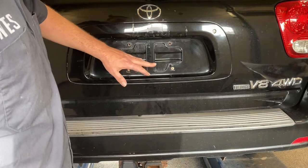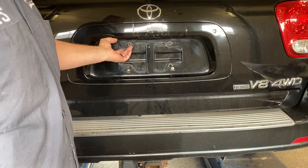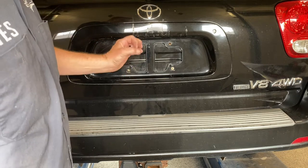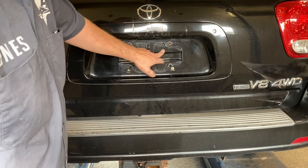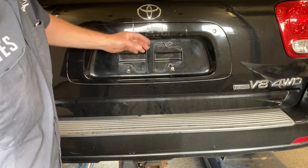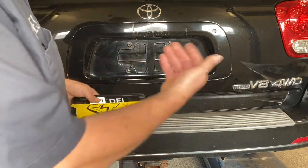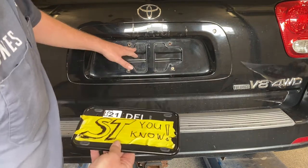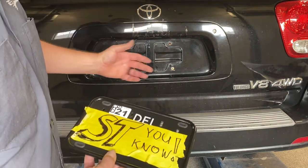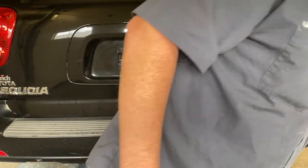A problem that Toyota is known for is the nuts — they're actually called nut certs. They're like a rivet sort of, and I'll show you what they look like in a bit. They're made into this lift gate. That's steel back there, this here is plastic, but that's steel and that's what they're into. They spin. I was lucky to even be able to get the bolts out — a lot of times you have to cut them. What I've got to do now is take the trim panel off the inside and gain access to this.